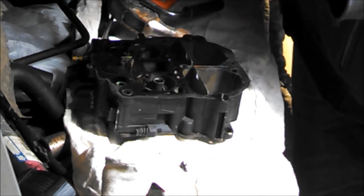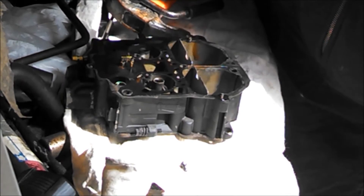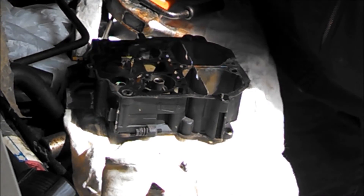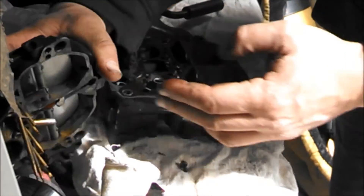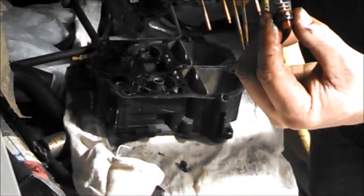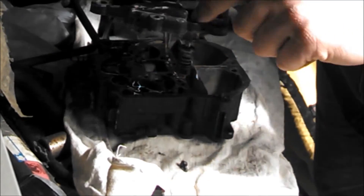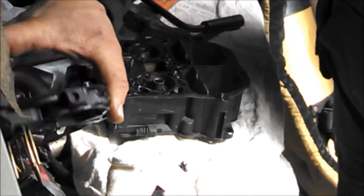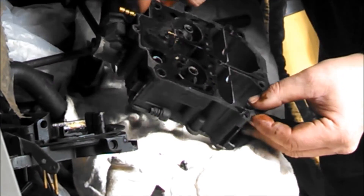It's well lubricated — the gasoline turned to oil. You'll be able to clean these up. I was thinking there was a lot worse in there. Even the cup for the accelerator pump will probably be able to be reused once we clean that out. I think this carb is going to be more of a clean-up than a complete rebuild.